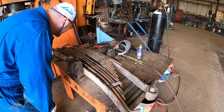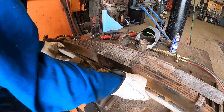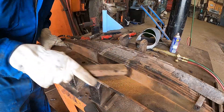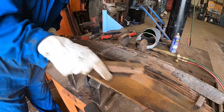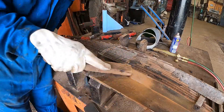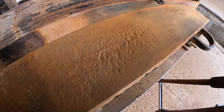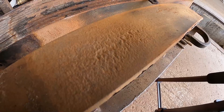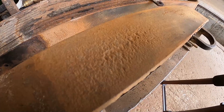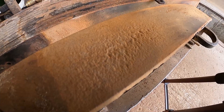Just taking a first glance at these leaves, I can see that a couple of them might be pretty rough. So here we go on leaf one — we've already got some heavy pitting in there. Those are actually tiny little cracks, and there are hundreds and hundreds of tiny little cracks already starting in there. It looks like these go probably about a quarter to a third of the way into the steel, so you've lost about a third of your strength in the material.